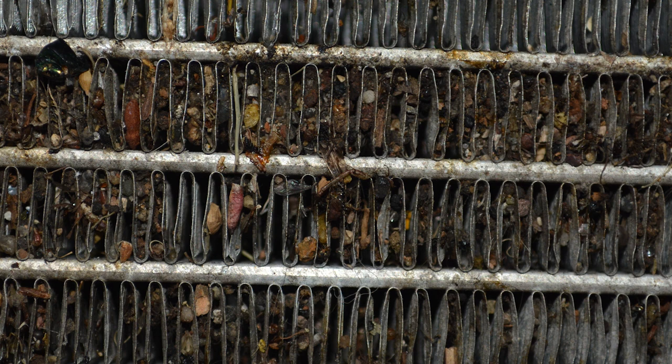As you can see, that is the main radiator close up — there's not going to be any airflow through those fins. You're not going to be able to vacuum any of that out; it needs to be soaked, washed, and pressure washed. It is an absolute horrific mess.